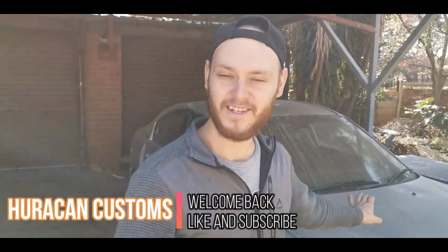So in this video, we'll work on a new build. No, I'm just kidding. We're just gonna finish the Mazda. There's a few spots left on it here and there. We have to put some micro stopper fine, sand everything, and then we can give it some paint. So it is basically done. The bodywork, everything is done, as you've seen in our previous videos. So I'm just gonna do the micro stopper fine work, and then we can give it some paint. Cool.